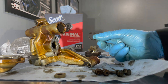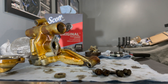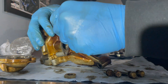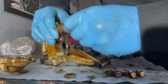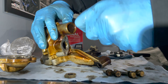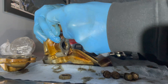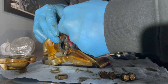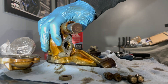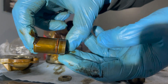Once we have the snap ring out, we're going to put pressure on this sleeve here. Some come out pretty easy, some are a little stuck, so we'll see how this one is. I'm basically just going to push this in — you might need something to help you push. I might use a little extension here. Kind of just work it back and forth, make sure it doesn't shoot out. As you can see that just popped out.